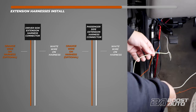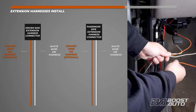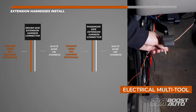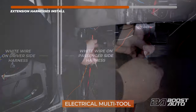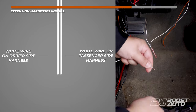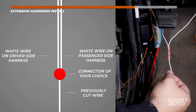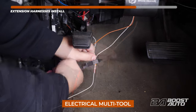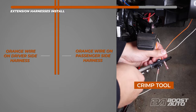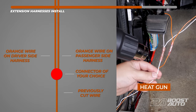We're going to grab the white wire from the driver's side and the white wire from the passenger side and route them under the hood. If you opted for running light, you will also route the orange wire from the driver and passenger side under the hood. Take your white wires and cut and strip both ends, making sure you have enough slack when passing inside the cabin. Combine the passenger and driver's side white wires together using a butt connector — however, any method can be used. Grab the excess wire you just cut and crimp it to the other side. If you opted for running light, perform the same steps on the orange wire.